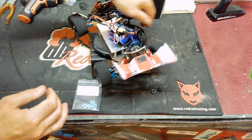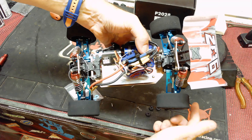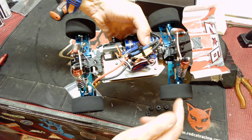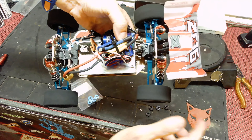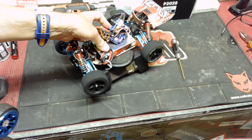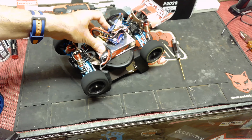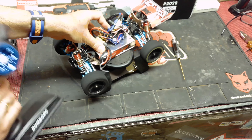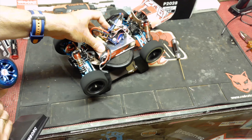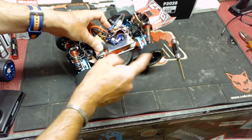The other day there was so much friction that either one wheel or the other wouldn't turn — somebody was essentially holding it — because the plastic hex squeezed against the hub carrier was acting as a brake. Now they roll completely free. Check out how long those wheels carried on spinning after I turned the throttle on during the bench test. That appears to have solved the stiffness problem at the rear end. Time to take it out for a quick spin around the yard.